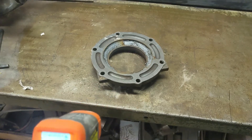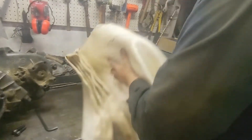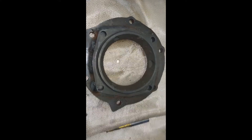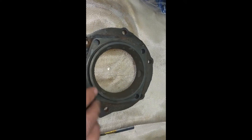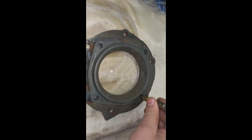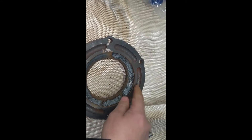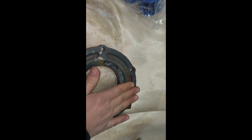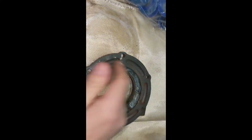I think we can put it in the oven to cool. So we're just going to wrap this thing up and let it cool. Now that I have the two pieces glued together, we have to transfer these holes. These four are the ones that go into the transmission, so we're going to drill these out. I've got the closest bit I can find — it's a slight bit loose but I think it'll be okay. I'm going to drill those holes through this plate and countersink them so the bolt heads sit flush, so we can bolt the whole adapter up to the transmission and then bolt to the transfer case with those six holes.